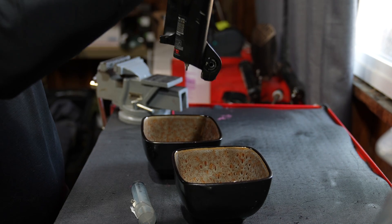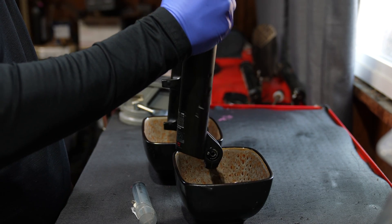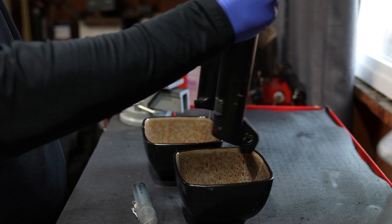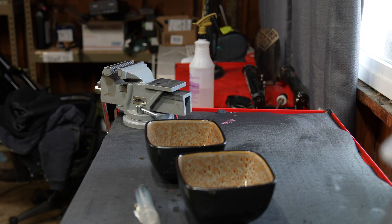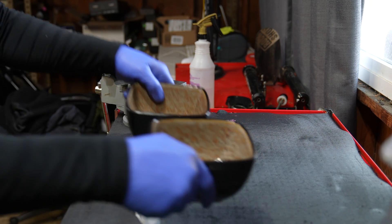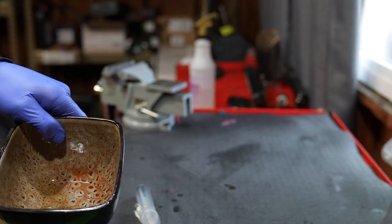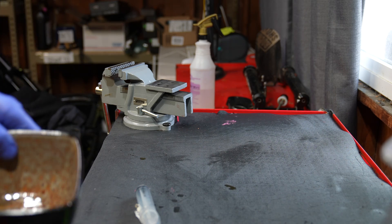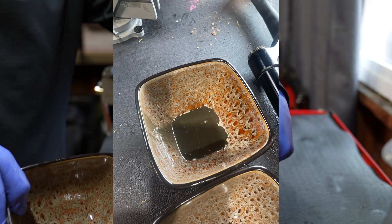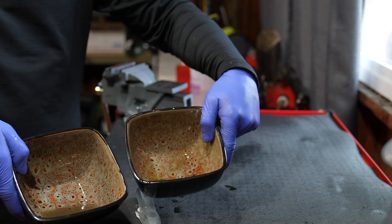Get two bowls underneath the lower legs and release all the fluid from them. I'm assuming you're a home mechanic in your garage, not a professional bike shop. We catch that fluid and do an inspection — the lower leg fluid is really clean, so I'm confident to reuse every single seal, O-ring, and washer in this fork. If it was a muddy mess, you'd need to replace everything if it's heavily worn.